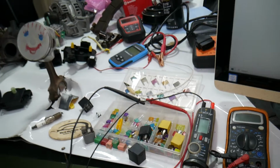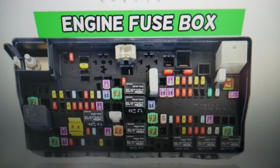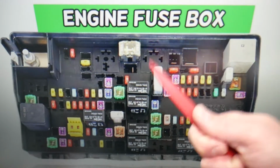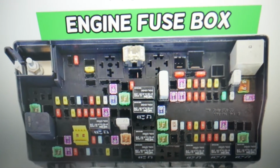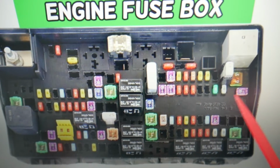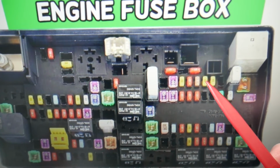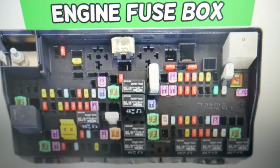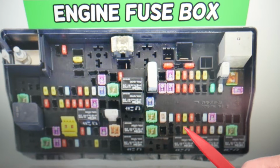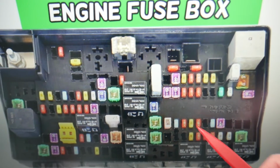Please check it out. For the trailer turn signal, two fuses will need to be checked, but make sure you stay until the end. We want to give you one quick advice so you don't end up being stuck in the middle of nowhere like we did. The first fuse that you need to check is fuse number 53. So that's here 50, 1, 2, 3. That one here, 20 amp fuse. The second fuse is fuse number 81. So that's 79, 80, 81. Right here, very important fuse.